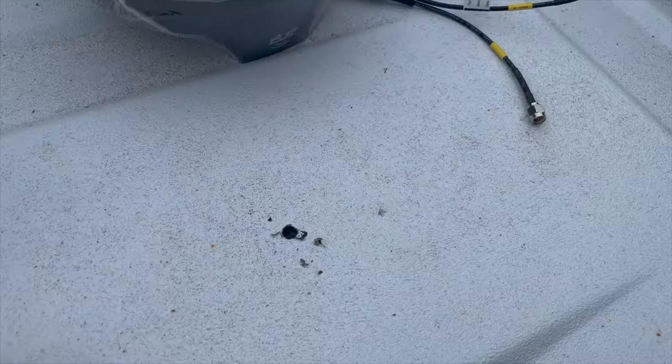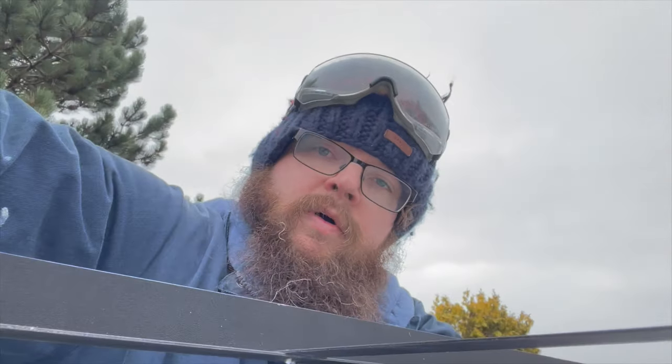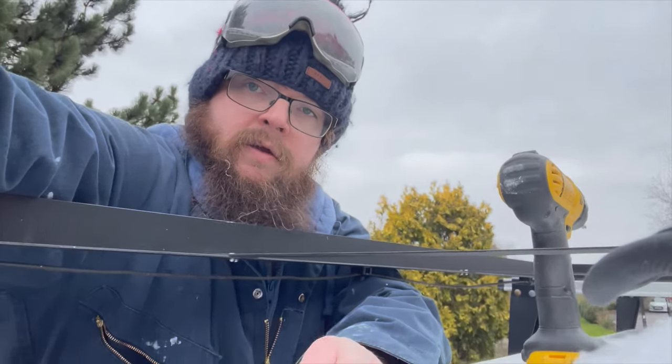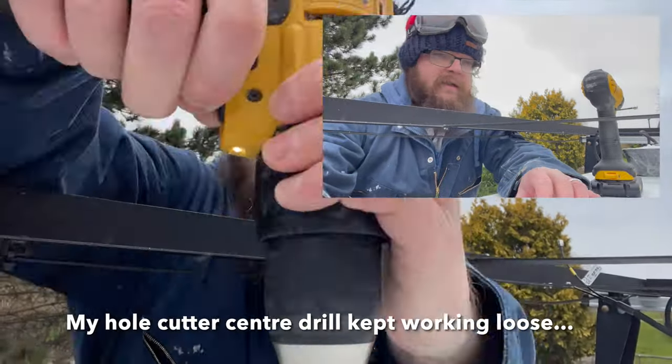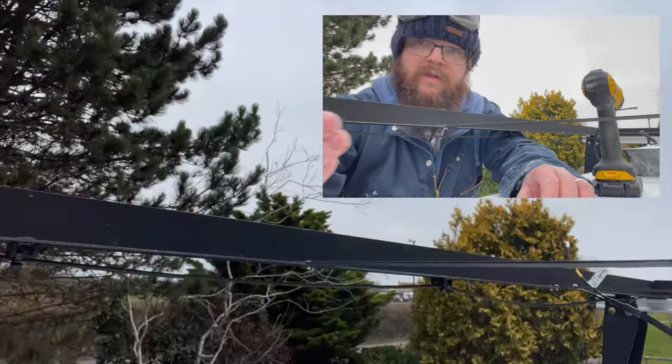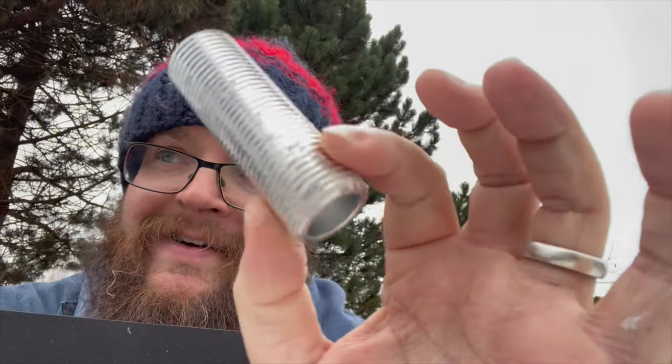It's through — I didn't like the sound of it though. Let's go have a look. We've come right through in the middle of the panel, almost like I planned it. The next thing you need to do is drill a 25mm hole with a hole saw from the outside in, set the drill to a low speed, and drill that through. Sweep up any swarf up here — the roof is pretty untidy and unclean at the moment. Now the next stage, if you've got the correct length threaded bar, is to attach the threaded bar to your antenna, put it through the roof, and do up the nut.